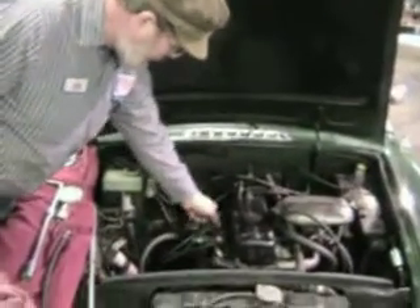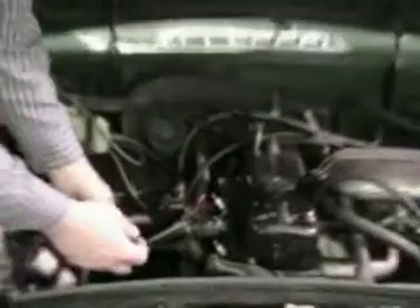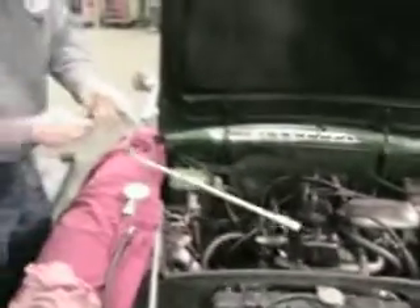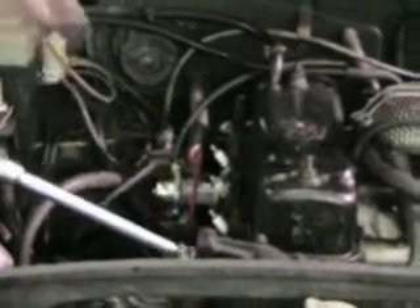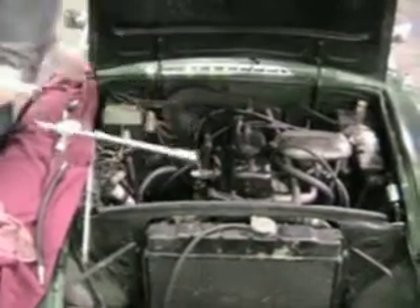So to check the compression, we're going to pull off the plug wires, and I would encourage you to pay attention to where the plug wires come from. Nominally, the number one plug comes from one o'clock on the cap, and the rest of them run one, three, four, two — but sometimes somebody's already had the thing apart and that isn't the way it is. So we're going to take out all four spark plugs. I use a speed wrench here because you don't end up putting too much of an angle on the spark plug. You can very easily snap the plug if you're using a half-inch drive ratchet and angle the ratchet too much.